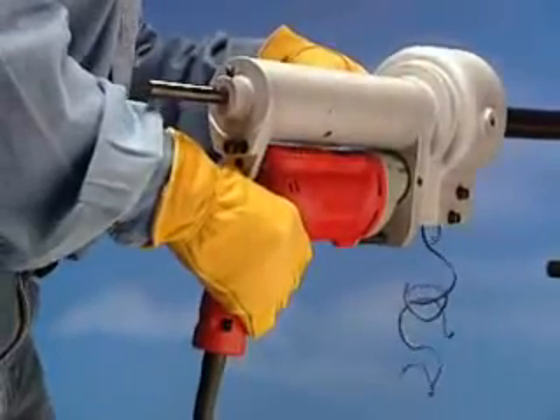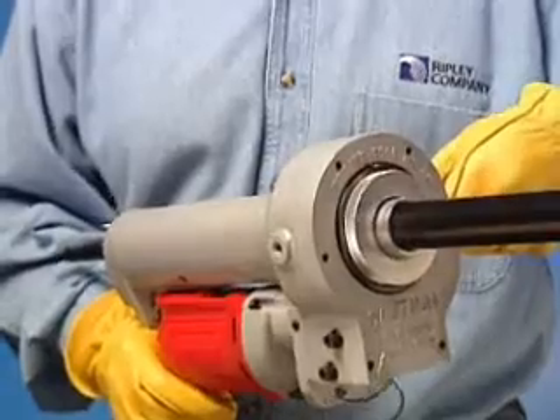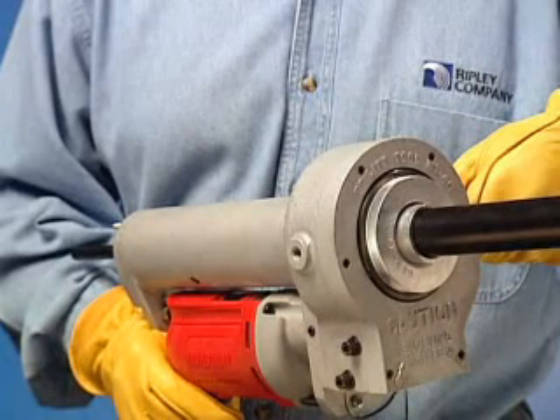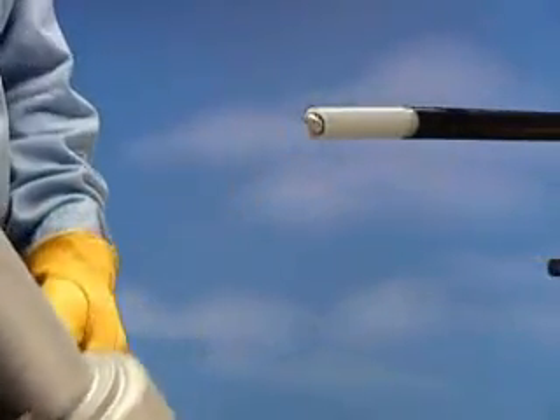To complete the operation, let the machine rotate 2 to 3 revolutions against a QC-1 quick clamp or a TC-1 transmission cable clamp. The WS-40 must stop completely before attempting to remove it from the cable. Remove the WS-40 and the master shaving bushing from the cable.